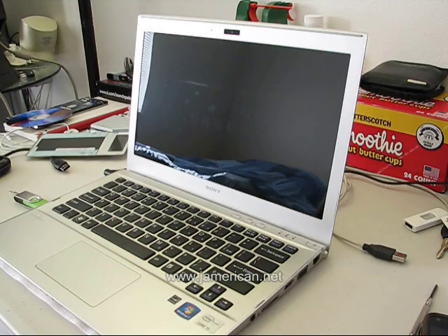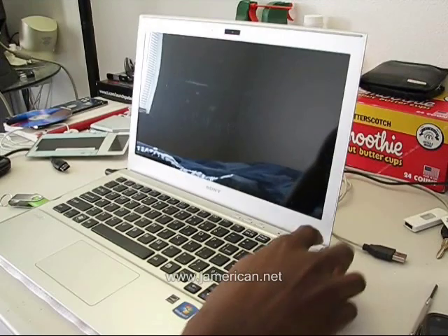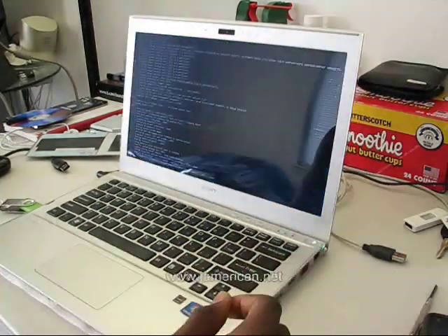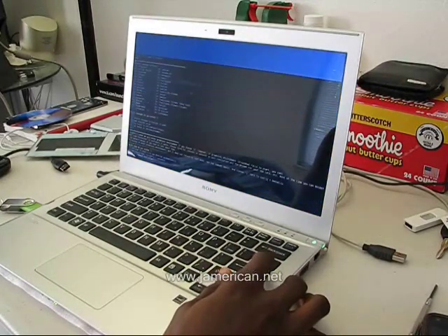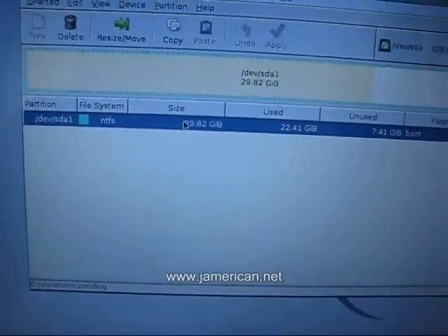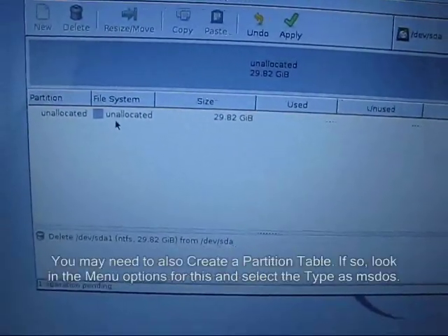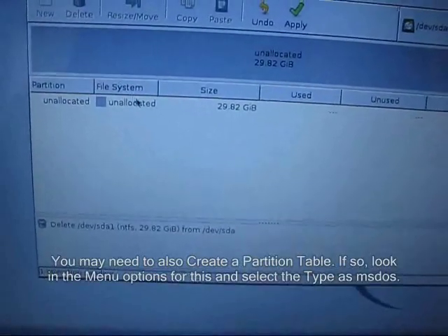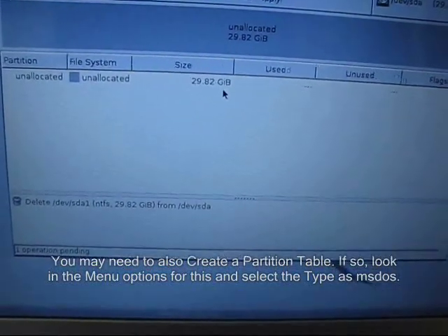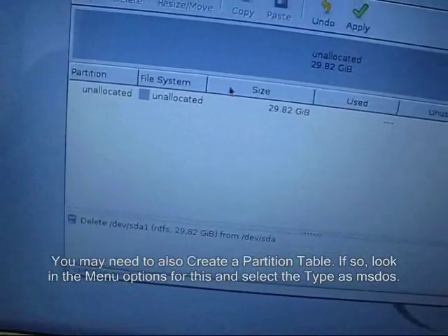After modifying your SSD to a non-RAID disk, plug in your 256MB GParted USB and turn on the power. You'll be greeted by a screen — push Enter three times through the blue prompts. You'll then be in GParted. Take the partition, which should be labeled as unformatted or unknown, and push Delete. You'll see 'unallocated.' If another one says unformatted, delete that too until you have unallocated, unallocated, 29.82GB. Push Apply, and when prompted push Apply again — it will now be unallocated.